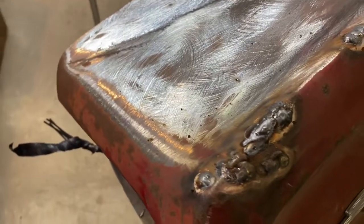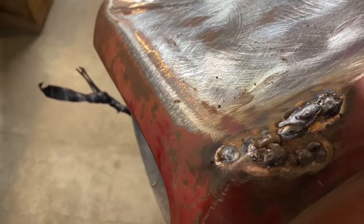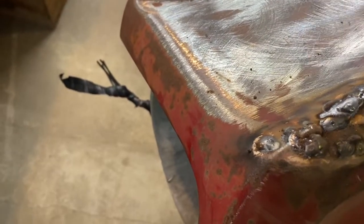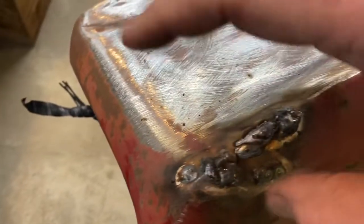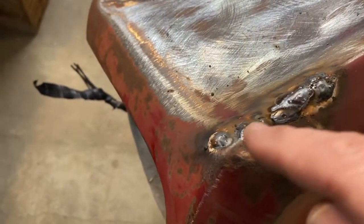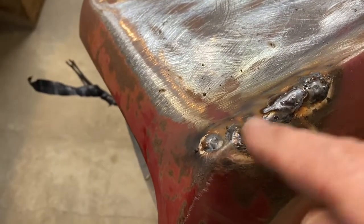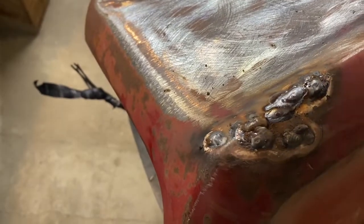It worked out exactly as I hoped. The 18 gauge was heavy enough I could just pour the raspberries to it. Because it is on a peak here, I'm not worried about warping so much. I'll tap this down just a little bit in here, but there's so many compound curves right in here, this is pretty strong. But I did go ahead and pour the raspberries to it and build up a little bead there so that I don't have to make this fender top piece out of fiberglass. I can just shape that out of the metal now.